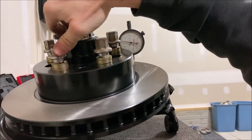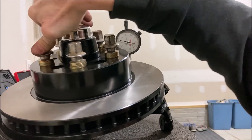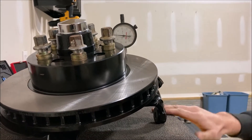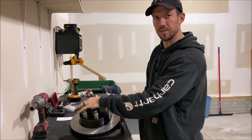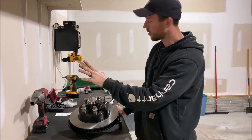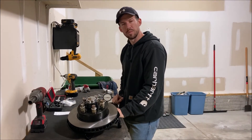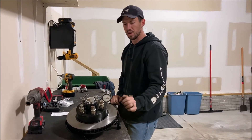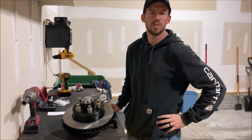There's my low point. Going all the way up to not quite four thousandths. That'll do it — I'm within spec on this one too. Even though we couldn't get the proper adjustment tool or adjustment shims, just using a regular old shim pack and measuring them up, we got it within spec. This one is ready to go on the car — put the caliper on, and should have good results.